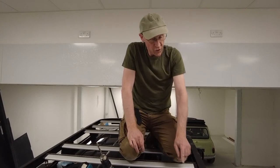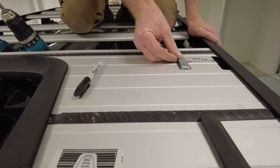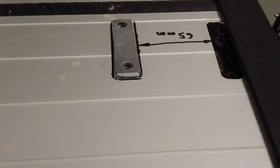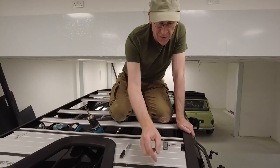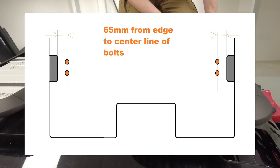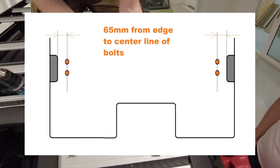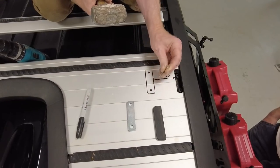We're on the roof now. We've worked out where to drill. The plates go underneath. The spacing of the rails centre-to-centre is 860mm. If you measure 65 millimetres from each end and draw around that, it gives you the location for the two holes. We're between workshops so no centre punch — we're using a screw to mark it.